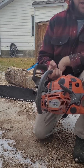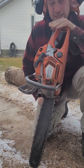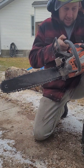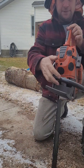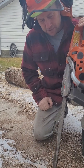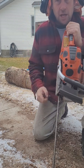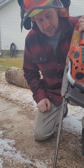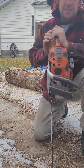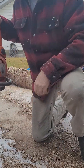You could probably hear it on the first two feet — felt it readjust. This one has a custom aluminum muffler and some extra vents on it. These 550s as well as the 562s — the earlier models — had a lot of issues with overheating. Some of that was because they run lean, but some of it is just how they were designed. I did a few mods to help that out. Take care.